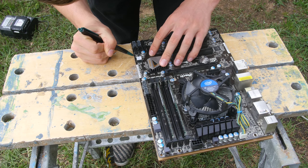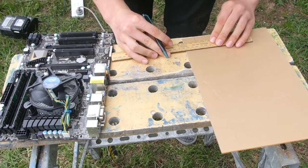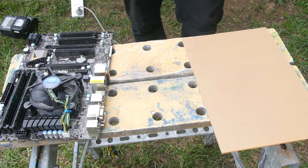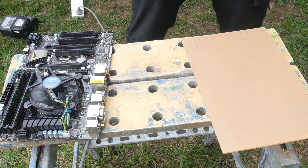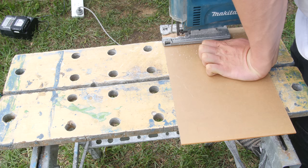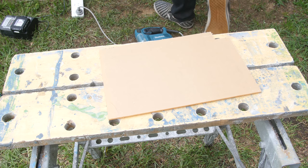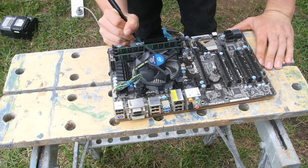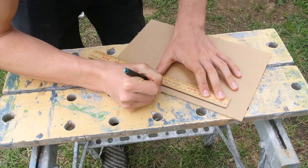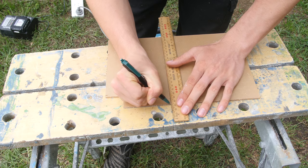At the moment I'm marking out the sections to cut out of the motherboard armor which I want to be visible so I can plug my cables in. I'm taking out the SATA cables and all of the IO cables down the bottom of the motherboard such as the power, a few fan hubs, reset and audio hub. I also want to take out the 24-pin and a couple of the fan hubs to the side, so I'm going to mark that out using a pen and a ruler. Pretty simple, taking my time when cutting to make sure I get nice and straight lines.